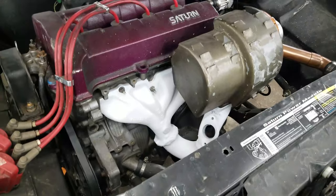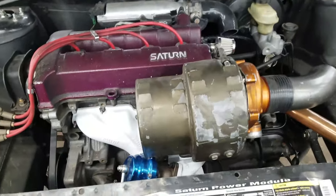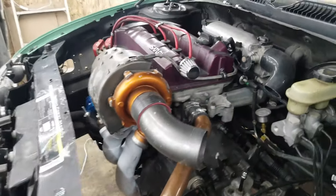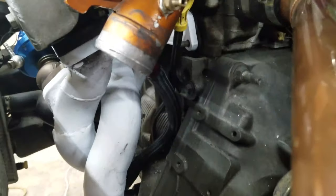Got the motor dropped back down and everything clears - thank god, that worked out great. Got the manifold on as a test fit, made sure everything closed up good, and the manifold is all nice and white now. Figured out the oil return and feed lines. Ended up having to chop the hood up a little bit just to get the oil line to fit - it kind of sticks off the back a little but the drain pipe hugs around nicely. Today has been a productive day. Like, comment, subscribe and we'll see you later - peace.